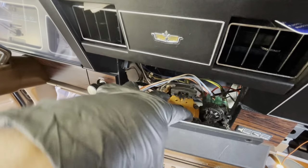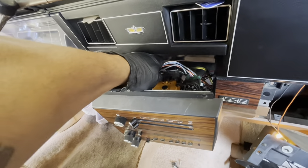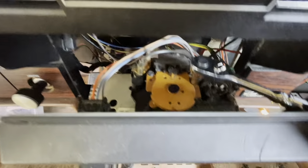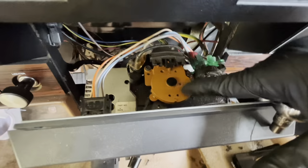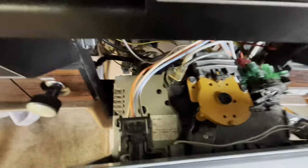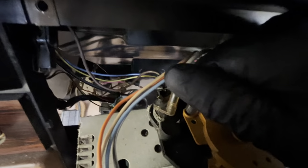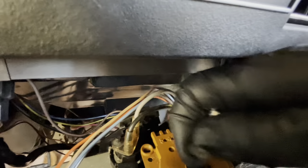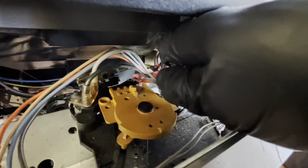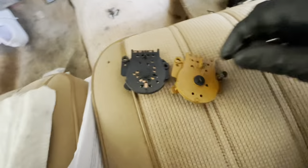It's just two screws — unscrew those two screws and you really can't go wrong. So if it's unscrewed, your AC ain't working, this is going to probably be your problem. You don't have to buy a whole new head unit because you're going to spend $300 — you want to just replace what's going wrong. This is the blower motor switch — this is what we're doing. You got to be careful with the vacuum lines. Keep up with your little screws, it's very important. That's the switch.